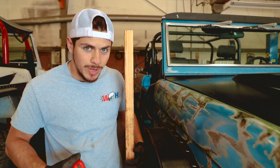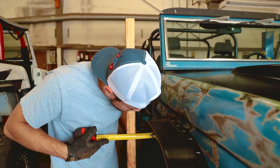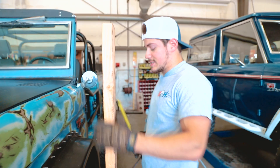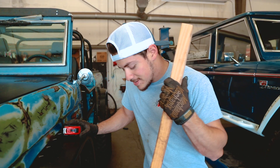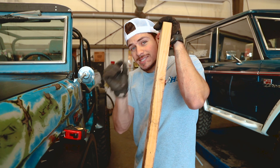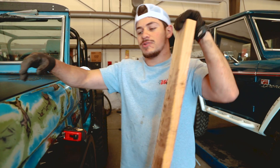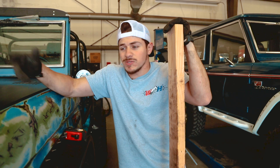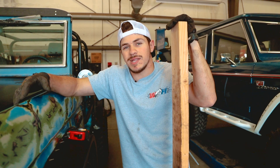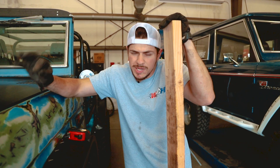Now what we're going to do is take that strap off, let all of the tension fall onto the track bar, and see how we make out. Cue epic music. So — like three and an eighth. Let's go measure over there — that's like two and seven eighths. Do I want to get picky? I'm going to call it good. A lot of people recommend you don't want anything more than a 16th of an inch of difference, but we're going to call it good. If you guys want to get that last little eighth of an inch, you can go ahead and do that. We'll see how it travels — if it's still all weird, we'll dial it in.